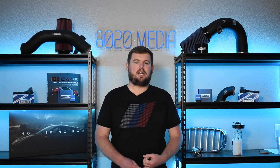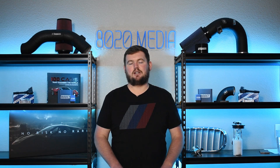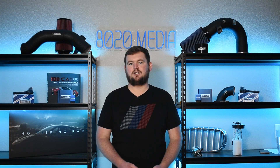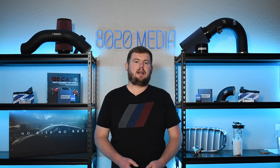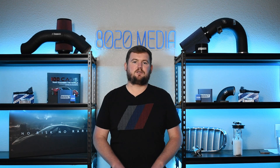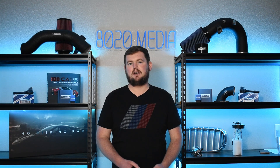Those timing chain guides are just something to keep an eye on roughly every 120,000 to 160,000 miles. Most of the issues with the M60 that you'll run into are simply going to be age-related. Outside of that, the M60 is a great engine and has been a great engine for its whole life, and continues to be an engine that a lot of BMW enthusiasts really appreciate and respect — often still considering the M60 as one of BMW's most reliable and best modern V8 engines.